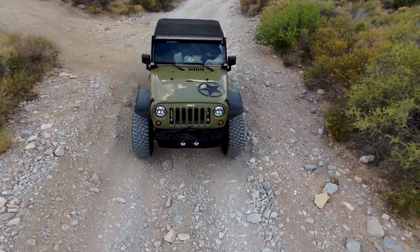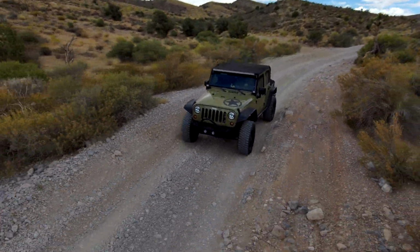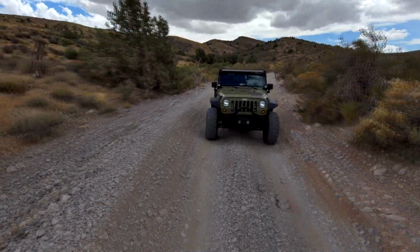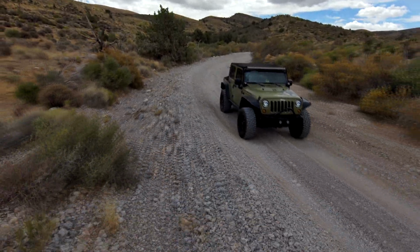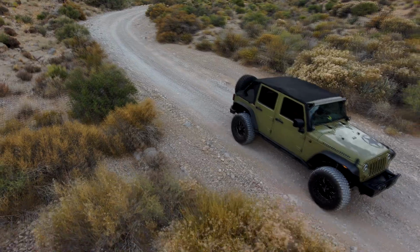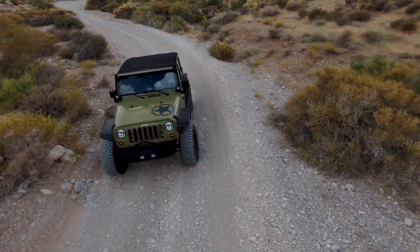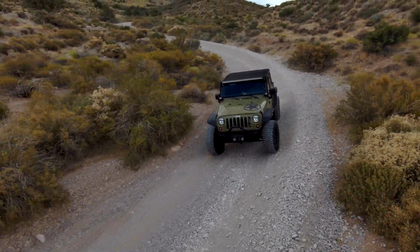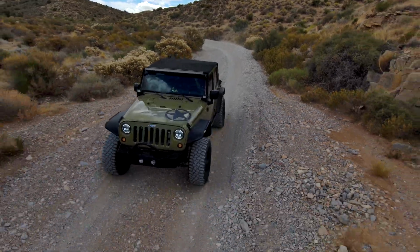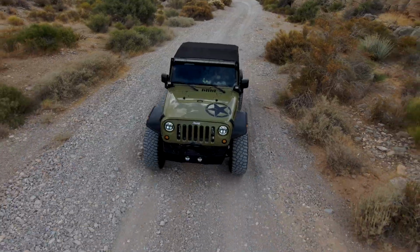And one final thing, we do have a fan controller, guys, and I've sold quite a few of them here recently. We don't really market it, but it's like nothing else out there on the market. Our fan controller, and I'm going to be doing a video on it, we've been running it for years. Our fan controller can take an analog or a CAN input from either a GM or a Chrysler system. What that means is you can hook 2 wires up to the CAN, and it'll get all the signals it needs to run the fan. And that includes transmission temperature, AC pressure, engine coolant temp, vehicle speed, intake temp, all that stuff.